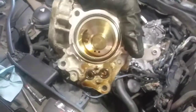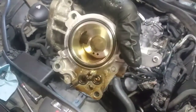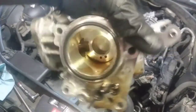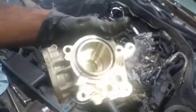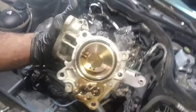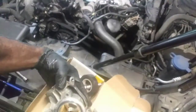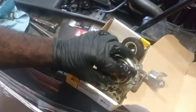There's an O-ring here. There's a gasket that has like an inlet and outlet, and those two openings down there, those little orifices, are what lubricate the end of the cam, and likely the lifter for the high pressure fuel pump, which is good. I've seen some that had inadequate looking systems. This looks very well lubricated.